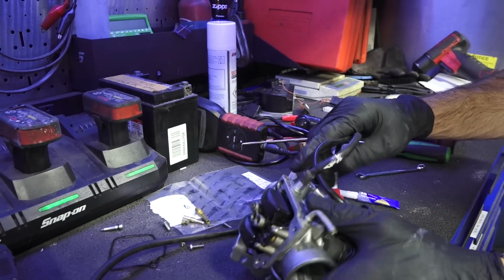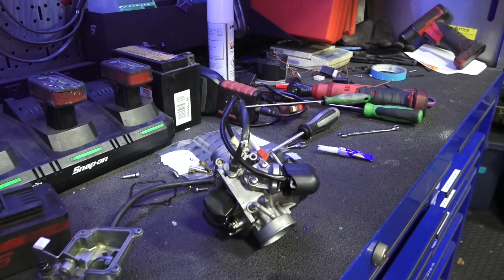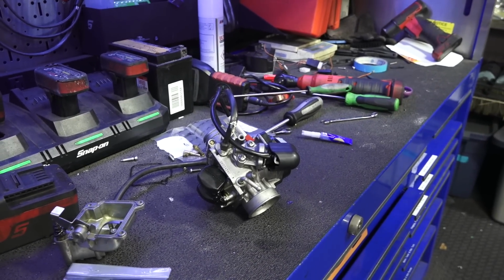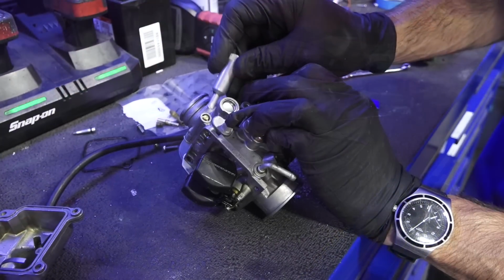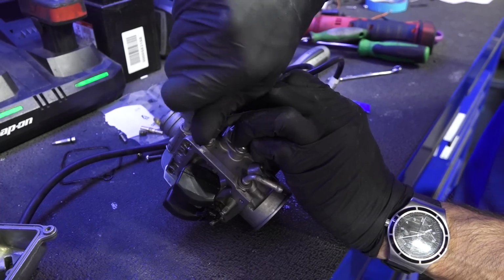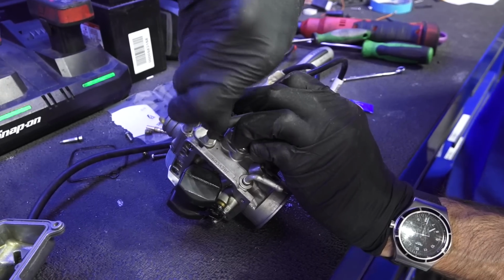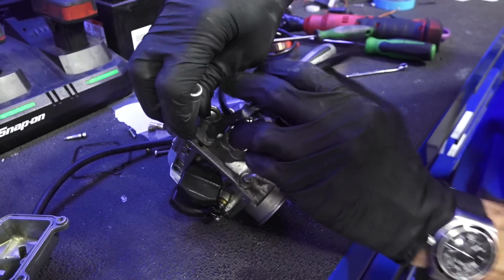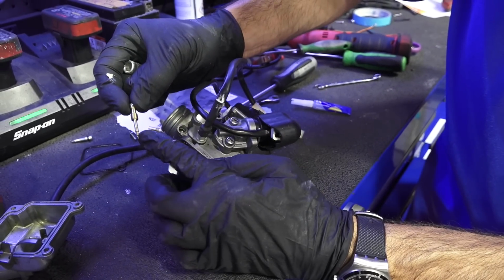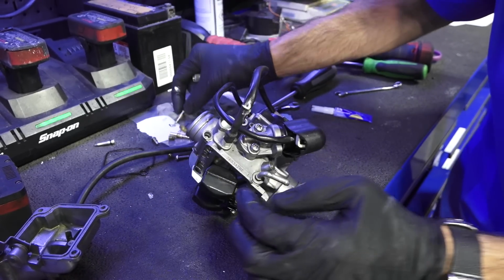The last thing I pull out is the mixture screw. A lot of amateurs that take these apart, they'll lose the O-ring, the spring, and the washer that's located in the mixture screw. So on these later carburetors, you can see it's like a D-shaped security screw. We do sell the tool. You can look in the description of this video for the part number for the handy little tool to remove the mixture screw or make adjustments if needed. And I can see there's a little ridge of grunge on that mixture needle. It's never going to idle right with that grunge on there.